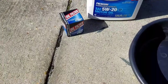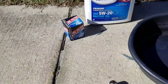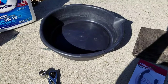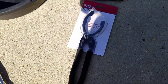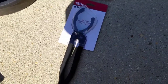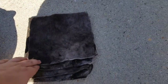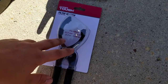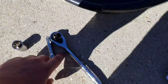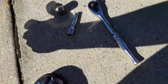So here's pretty much all you need: of course you're gonna have the oil and the correct oil filter. You're gonna need an oil pan to put all the old oil inside and recycle it properly. You're gonna need some oil filter pliers or different kinds to take off the oil filter — they have socket-style cups for it. I prefer those but these were only four bucks. You're gonna need a rag — just an old rag — you wrap it around the filter and tighten. And you're gonna need a 19 millimeter socket with a 3/8 drive, and an extension if you like.